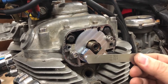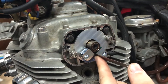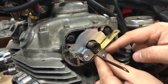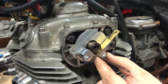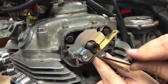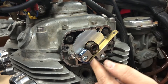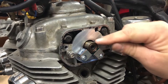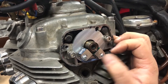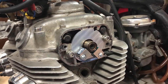First thing to do is I'm going to use a 14 thousandths to start with. I'm going to put my 14-thousandths feeler gauge between the plate and the sensor, then take my 10 thou and put it like that — making them basically intersect there. The point of the 14 is if I have to move the sensor over, I can. I'm going to hold that right there, kind of keeping pressure pointing up at that corner. We're going to snug it down. So now this particular sensor is 10 thousandths from the cam and it's 14 thousandths over from the wall. To set the timing on this one, we're going to have to either bump it left or right — we might have to go up to like an 18 or 20 to find the spot where it's in time.